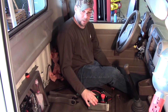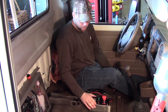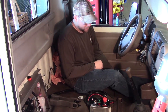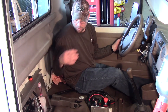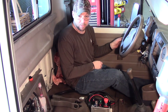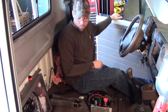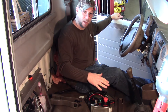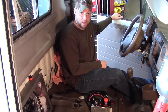Now that you've got your brakes released via your panel, we're going to test to make sure our door switches are working properly. All you've got to do is open your door, and this will alarm and it'll dump the pressure if your door switches are working properly. What it's just done is automatically set the parking brake, and now you can just push your red button and go ahead and get out of the vehicle.